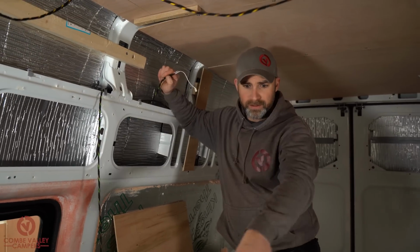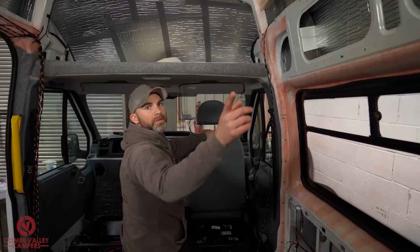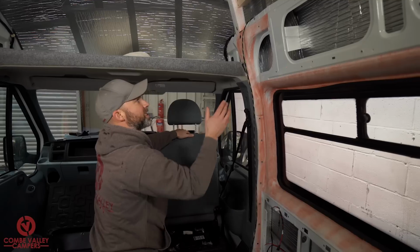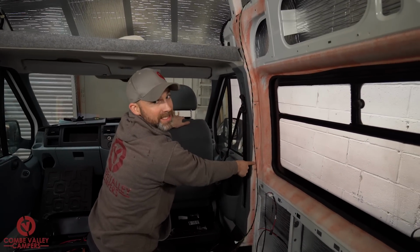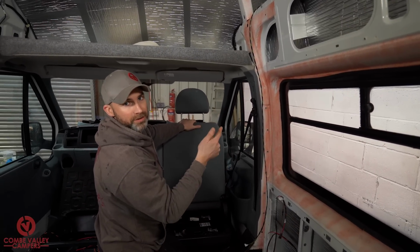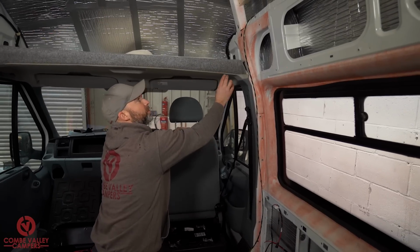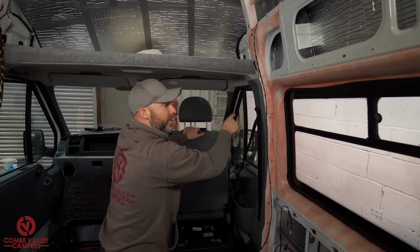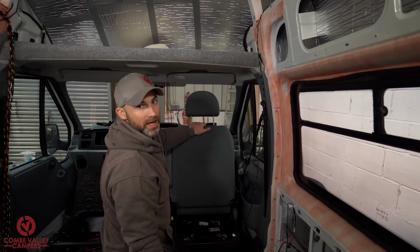I'm now going to route the cable back down towards the battery. We followed all of the clips through, and now we want to bring the cable down this B pillar here. Now it doesn't seem obvious where the cable's coming through yet, but I can see an existing wire or part of the existing loom coming down here. What I'm going to do now is go and get some tools. We're going to need trim clip tools, Phillips screwdriver and some spanners, because we need to remove this seatbelt point, remove the plastic trim, and then just pull a couple of clips out of here to then pull down the headliner slightly just to see where the existing cable route is, and then we're going to finish by routing this wire down in this B pillar nice and neatly.